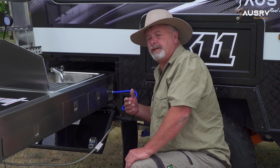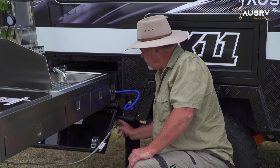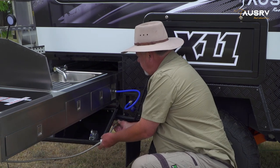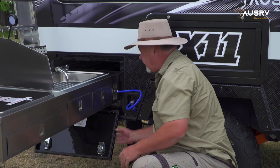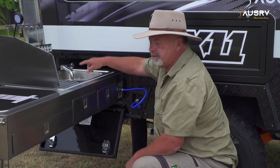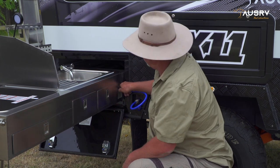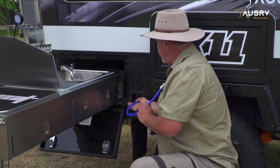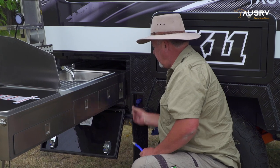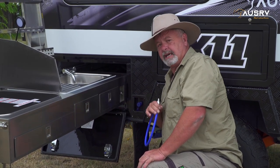When packing up the kitchen, first turn your gas bottles off. Turn off the gas at this little connection and we can start disconnecting. To disconnect the gas, pull the collar back and pull the hose out. With the water, make sure the water pump is turned off. Release any pressure through the tap so you don't get yourself covered in water when you release the hose. Pull the collar back and disconnect the hose. Now we can put our dust cover back on.